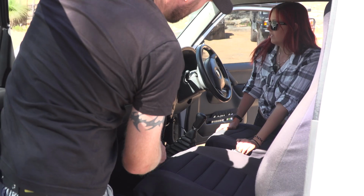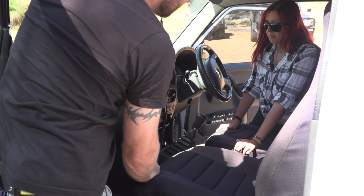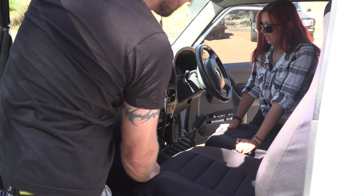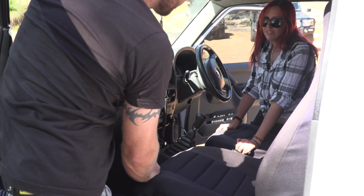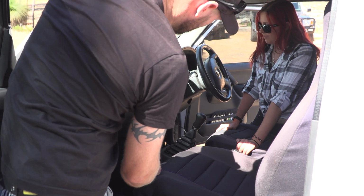How hot do you sort of run now? With the custom radiator and the thermo fan, I run pretty much 80. Even in peak hour traffic, it'll come down to 80. Yeah. What were we running before, do you know? It would run up to 90 quite often, and sometimes getting closer to 100 just because of the engine conversion. Yeah, you wouldn't want to go too far over 100, would you?